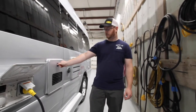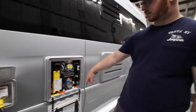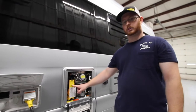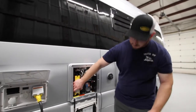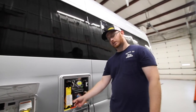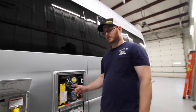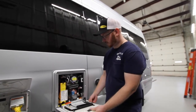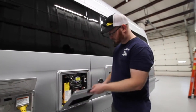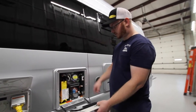Now the Truma water heater here — we have our open and close. Lift this up and place it down. We have our off and on here. This is where all the heat from the unit working comes out. Underneath what I call the duct bill, you'll see two little black knobs — when those are on there, the Truma water filter is in the unit so water won't come pouring out. Your water heater drain is right here and this is your overflow. The only thing to remember is the power switch — up or down doesn't matter, as long as it's on it will operate.